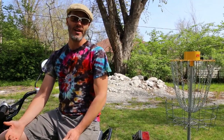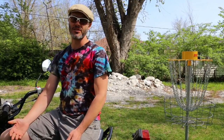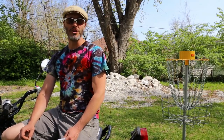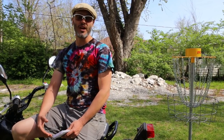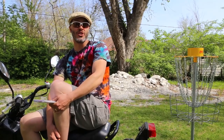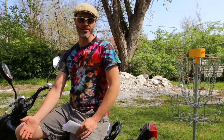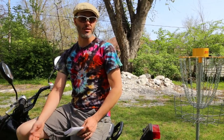I really like bikes and a big part of that is wheel building. I've been building my own wheels since I was 13. When you're wheel building, it's tough to get the right spokes. In particular, I wanted to use 12-gauge spokes to mate bicycle hubs with lightweight motorcycle rims, and nobody was doing that at the time. So I had some custom nipples made and got a spoke machine that I could roll threads into 12-gauge spokes — and also 13-gauge spokes for the front wheels, 12-gauge for the rear — to make custom electric motorcycle wheels.